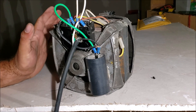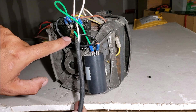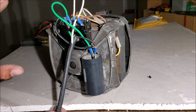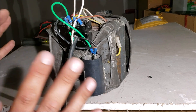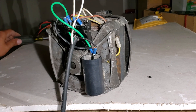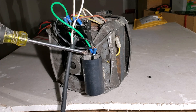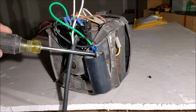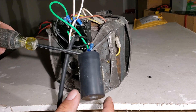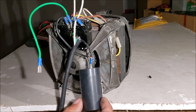If you're testing this outside on the ground, you must use your green wire and ground it to the copper tab or the body of the motor. We're inside a house, that's why we didn't hook up the ground — but you still notice I don't go touching all over the motor. The capacitor right here has to be discharged every time you touch it — it may pop like a firecracker, so be careful.